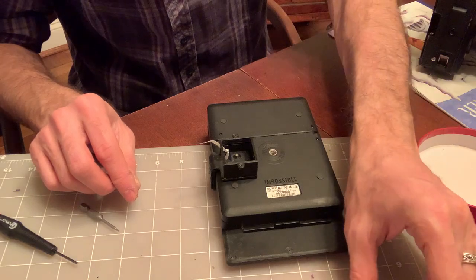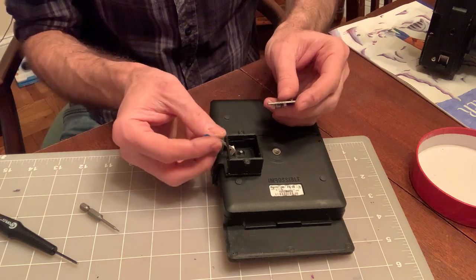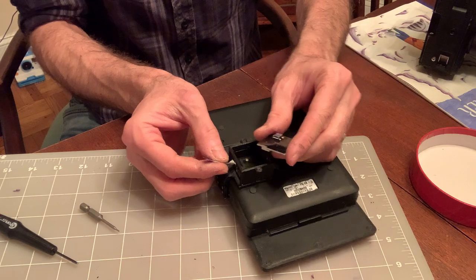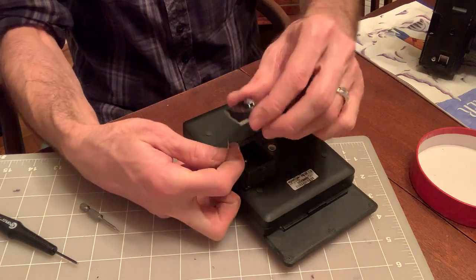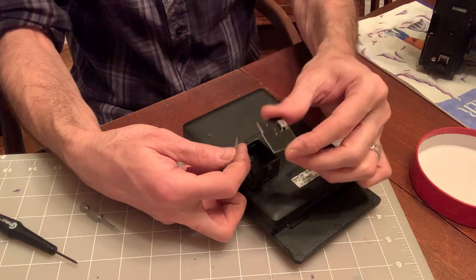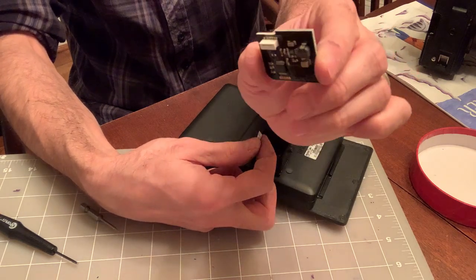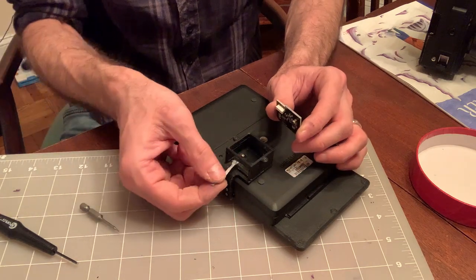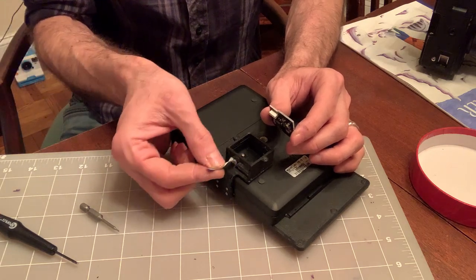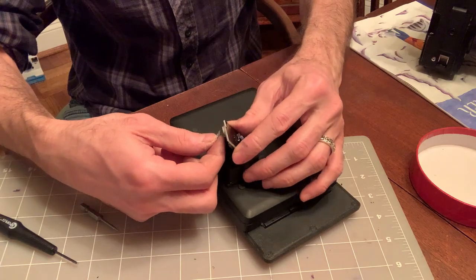What's next? Well, next we're gonna attach this other end of the ribbon cable to the eject box. So remember that it has a side that has the connectors and one side that says blue tape, right? So you want to attach it with the blue tape towards the eject button, like that. Why? Because the connectors are on the other side. So as it comes off, you have to twist it 180 degrees. You can't connect it like that. You have to twist it 180 degrees with the blue side towards the inside of the lab, and then connect it.